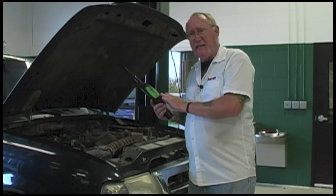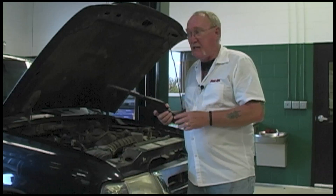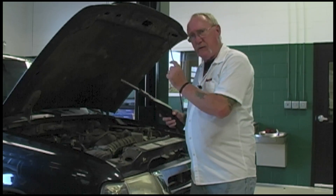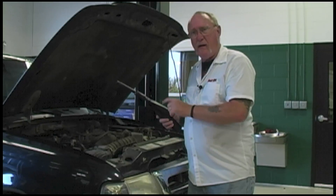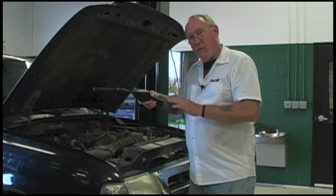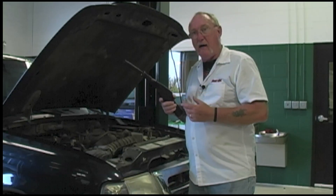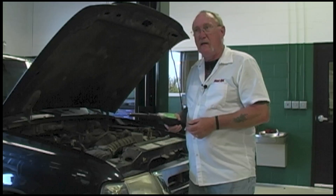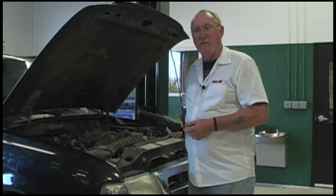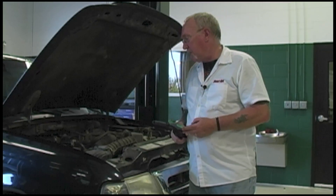Would I get this tool just for AC detection? No. But if your shop does a lot of noise, wind leak, and water leak work — take the emitter that comes with the tool, roll up all the windows, shut all the doors with the emitter sitting on the front seat and on. Then you can go right along the edges of all the door frames, window frames, and window seals to see where the sound is coming out. That will help you pinpoint the cause a lot better than taping things up and going on constant road tests, spending hours finding something you can find in a few minutes with a tool like this.